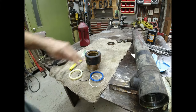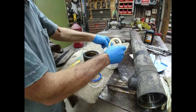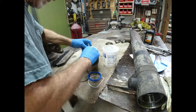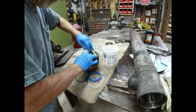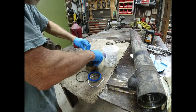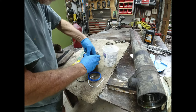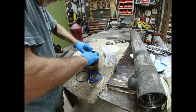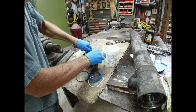I'm going to put some gloves on. This oil seal is not like a typical metal oil seal with a rubber lip - it is all plastic, some kind of hard, semi-flexible plastic, and it has to be because you have to fold it like a pretzel shape to get it in there. It takes a lot of force and you kind of think you're going to destroy it, but it went in there and snapped into place. It's not coming out without damage - like the original one, I had to really booger it up to get it out.